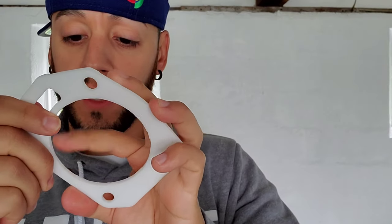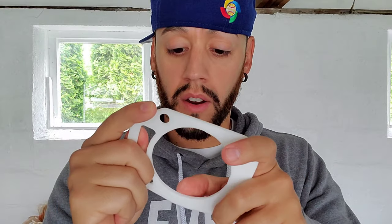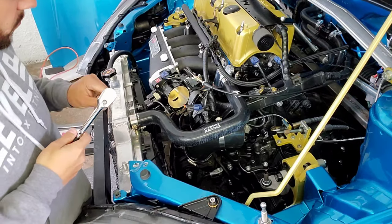First thing I'm going to do is start with this anyways. So I'm going to take out the throttle body gasket, put this one on, start the car, see if it whistles. So let's try that. Okay, so I was able to cut it out with a blade. I sanded it inside just a little bit so it's smooth. Make sure nothing is really sticking out that wind can cause an issue with, or air, I should say. All right, see how it goes. Wish me luck.